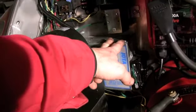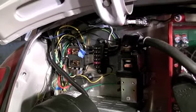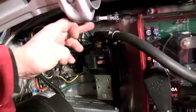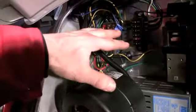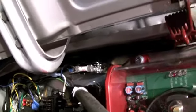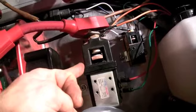The Iota DLS-55 DC to DC converter converts the high voltage to 12 volt DC. This here is a Curtis Albright contactor to give you power. When you turn on the key, the negative side is completed from the negative side of the pack to the negative of the controller. We have a couple of little fused distribution panels — everything is fused quite safely. Hidden down here in the corner is a little inertia switch: if you hit something hard it will cut off key-on power to everything and shut down the controller. There is another 30 amp high voltage fuse for the DC-DC converter and another one in line for the EV heater. The positive conductor is on the other side. This contactor is controlled by the controller — when you flip on the ignition for a brief moment it closes the contactor and you are ready to go.